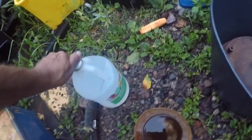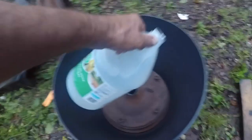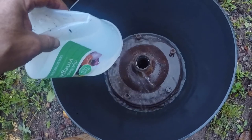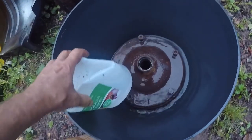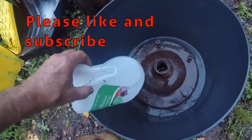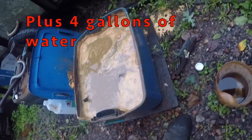I'm going to pour the regular old vinegar in and we'll see how much we get out of this bottle. We may not be able to cover the whole thing. A lot of people talk about Evaporust and it's a great product, but this bottle of vinegar costs me about $2.50 to $2.69. And another thing — Evaporust has a kind of a life, it can only de-rust so much metal. This vinegar has been here for weeks, I think a month, and I've de-rusted all kinds of parts in there and it's still going strong.